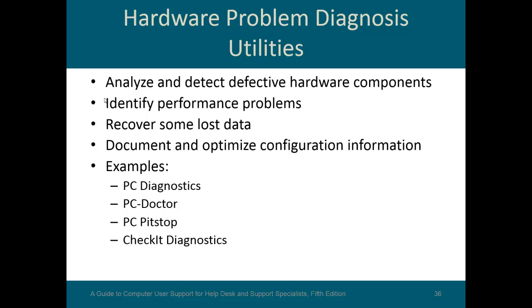Install a new operating system. Well, hey, that didn't do it, so it's got to be the memory or something like that. There are mem tests that you can just download from Microsoft, where you just reboot your PC and put the CD in, and it'll test your memory. Your regular Windows installations will do that stuff. So I'm not a big fan of third-party tools, only because most of them are free, and in order to be free, they also install crappy software on your PC.